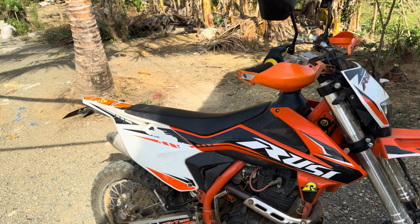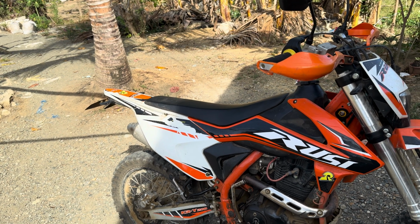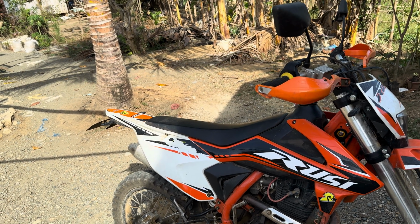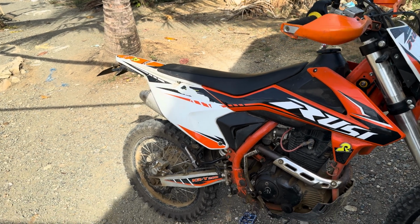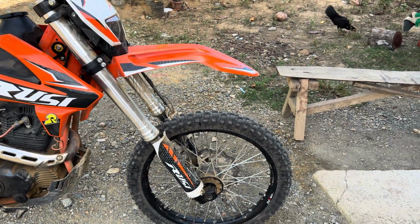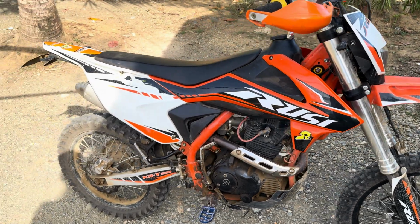and probably end up going with a wider rim on the back, because I like the stability it adds to the sidewalls of the tire. It gives you more air volume inside your tire. So probably go from this 1.85 to the 2.15. So this is a 160 on the front with rim, in case you don't know,